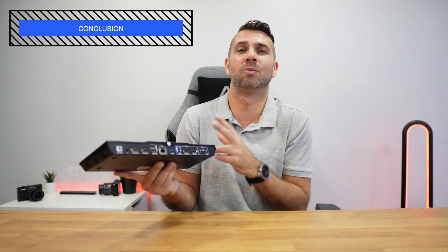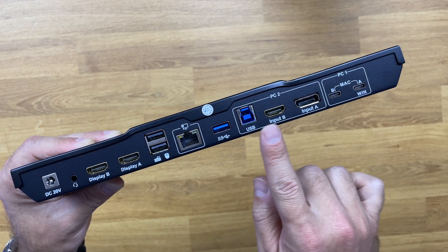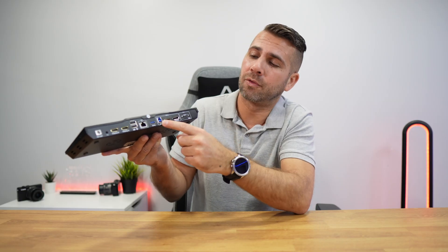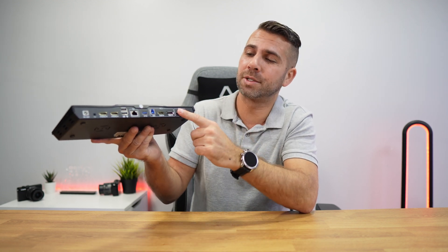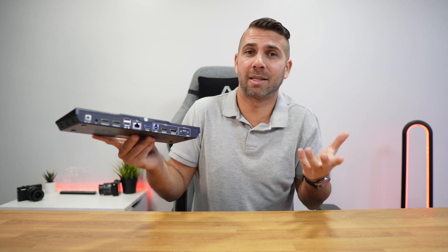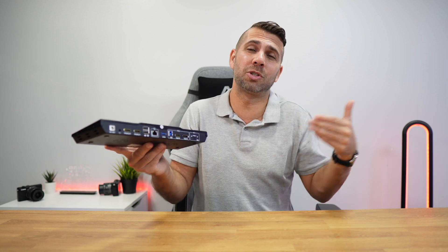The main advantage, besides acting as a docking station for a two-in-one solution, is the simplified cabling for a laptop and desktop setup. A classic KVM would require two HDMI or DisplayPort inputs for the laptop side, plus extra USB connections. But because this is designed for laptops, it uses just two USB Type-C cables that deliver video, data, and up to 65W power delivery — charging the laptop while in use.